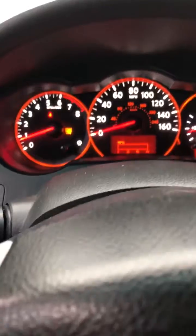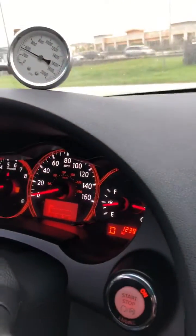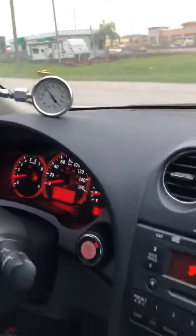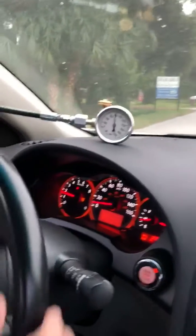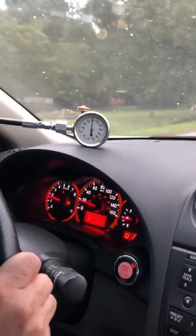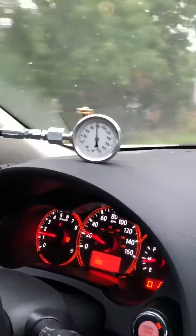Now when we go on a test ride, what I like to do is get the car up to 60 miles an hour. It's just a quick little test to give us an idea if our variators are slipping. We've got Garrett with us today holding the scanner. I just want you to look at the gauge as we're driving. Now we're starting to accelerate — about 800 pounds of line pressure, which is real good. This transmission is putting out good pressure.